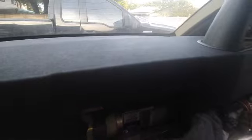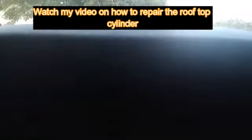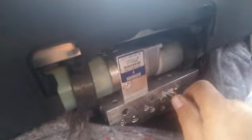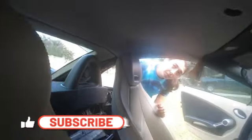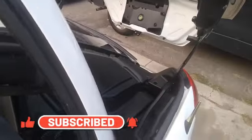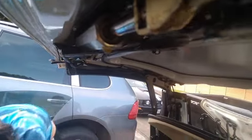After installing the fluid, we noticed a couple of leaks right on top. So we're going to have to open the roof manually. With an allen wrench, first you take the pressure out — that's already done — and then we unlock the roof. We were able to get it open and remove the bottom roof panel. We noticed a big leak on this piston right here; that's where the problem is. I don't know if that's fixable, but we'll find out.